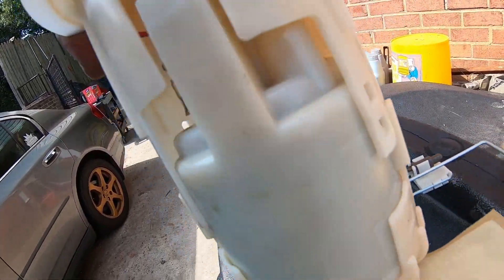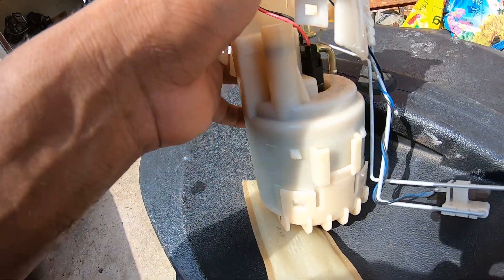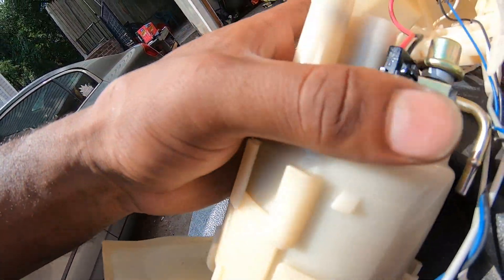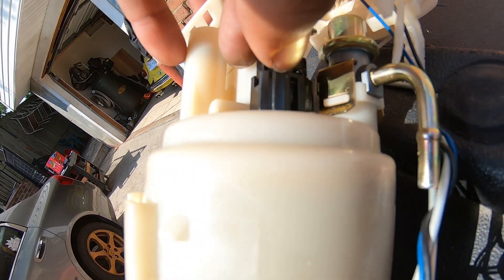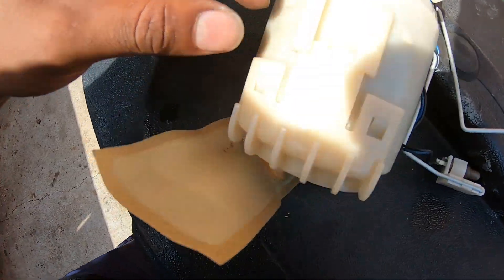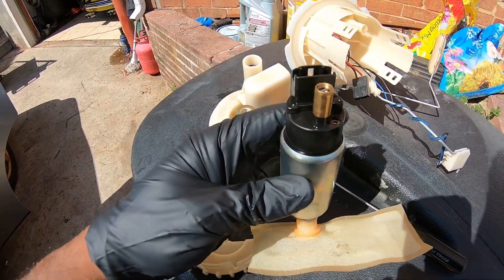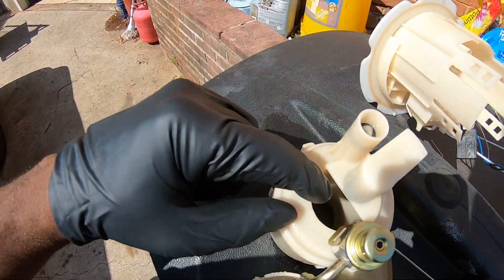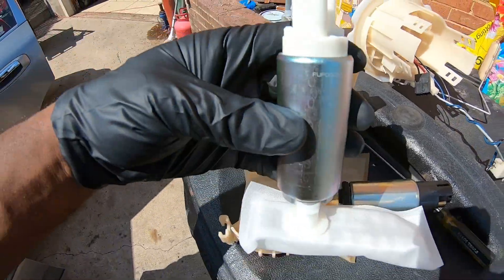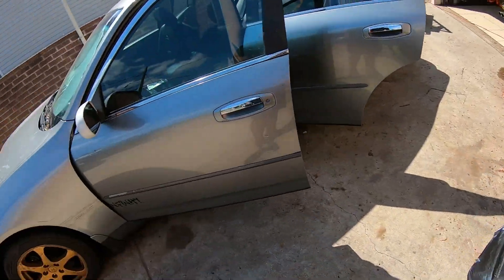And then this whole top part just pulls off. Those little clips come off, pull this up, and this piece will get off. Please be careful — this is plastic, don't be too aggressive or you will break it. Pull this connection off, take these clips off the bottom, and we'll get to the pump. This is what it looks like all taken apart. Watch the orientation as this comes out — make sure you put it back the same exact way. You can see how this opening is here, so the connector would be in that direction. Just get your new one, slide it in, and do this all in reverse order. This is how you remove the fuel pump on a G35X 2004.